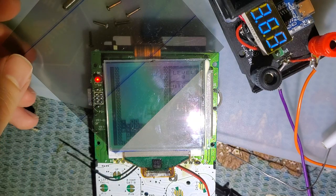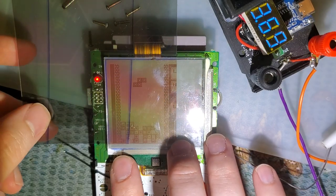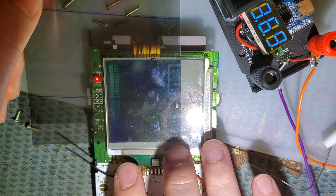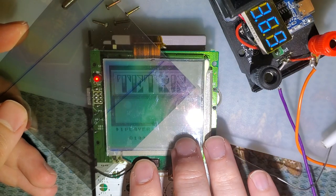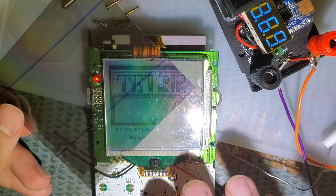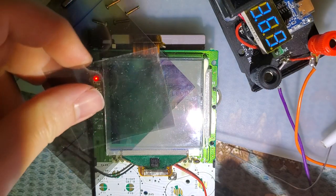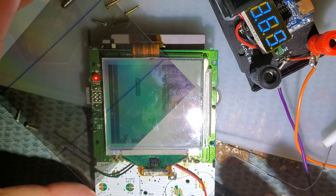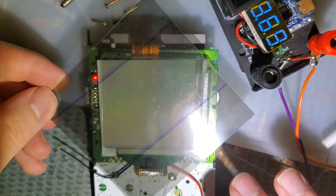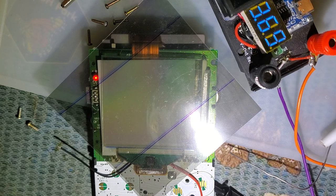But with the stock front polarizer, it's not 90 degrees on the aftermarket ones. You see both of these angles look like garbage on the screen. You want to use 45 degrees with the replacement polarizer. Otherwise, you're not going to get good contrast no matter what you do. Just thought I'd share. Polarizers are neat. But that's probably why these ones are cut so big, because at 45 degrees, I can still fit a whole screen in there. But anyway, just wanted to add that before I finish backlighting this pocket and upload this video.